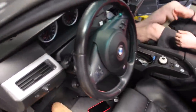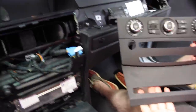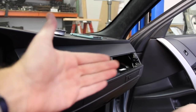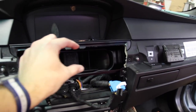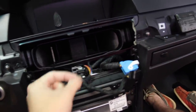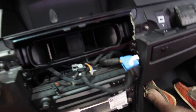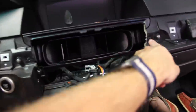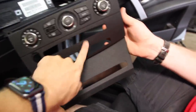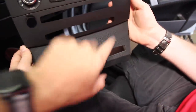Let's talk about interior disassembly — namely the center console. Step one is removing the wood or titanline trim up here with the vents. Use a non-marring plastic pry tool, starting on one side, prying it out straight. The only electrical connector is the switch in the center between the middle two vents for hazards and the central locking button. It clips in with four clips. Pop out the little switch and unplug it. With that out, we're greeted with two black Phillips screws that go through the center stack. It's the HVAC panel and surround panel around the navigation computer — all one piece.